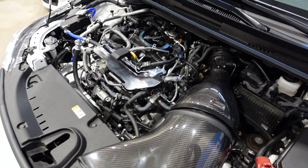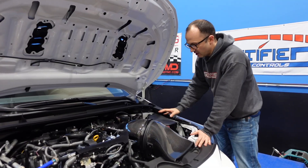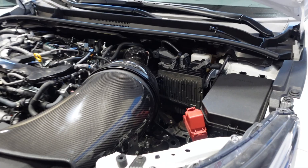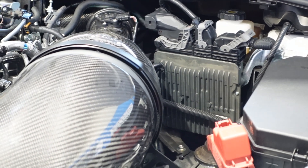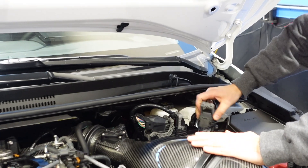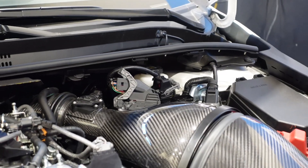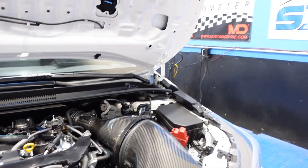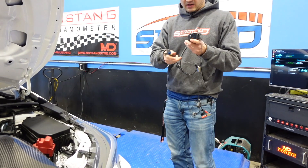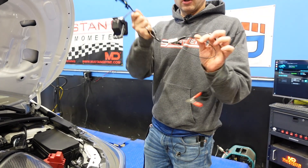The flashing process in this car can seem a little daunting, so that's why I just wanted to show it to you. If you come and look at the engine bay — it's got this beautiful Eventuri carbon intake here. Right behind it is where you locate your stock ECU. The stock ECU has three plugs, and these plugs need to come off for you to flash the car. You just remove the clips and move them out of the way. You're basically bench flashing the ECU, and in order to do that, you need to use this specialty harness — which we can provide for you — made by the good people at AccuTech.